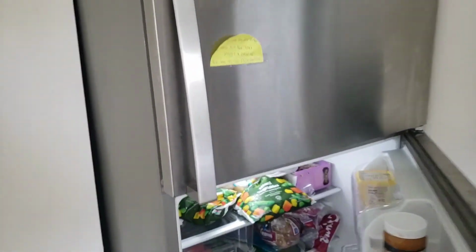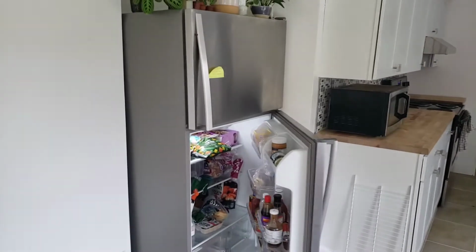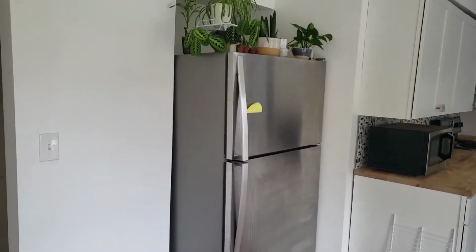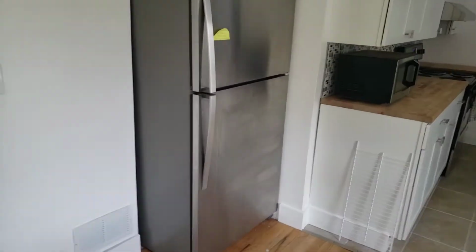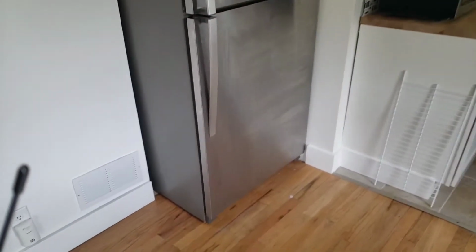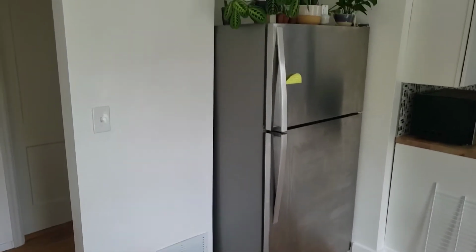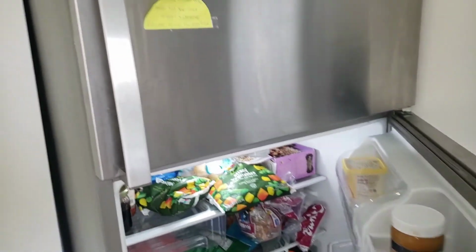This is an economy size, mid-range design refrigerator. It retails right around $800. The repair would run you right about one-third the cost of new, which would then be worth repairing versus replacing, due to the fan not forcing cool air down into the fresh food compartment.